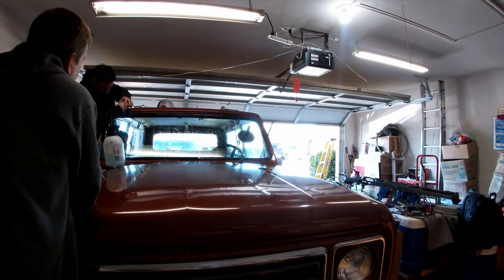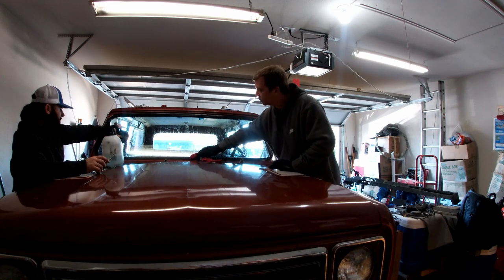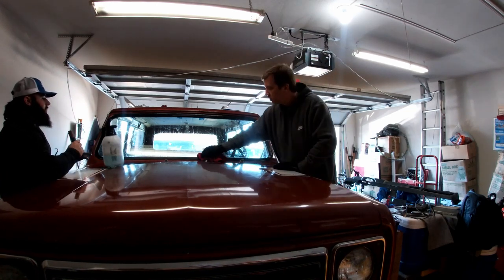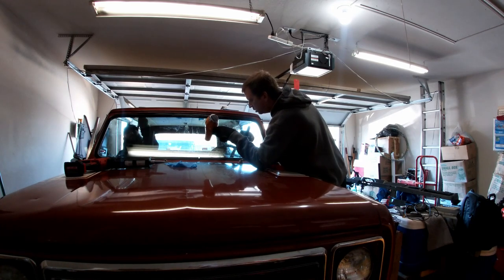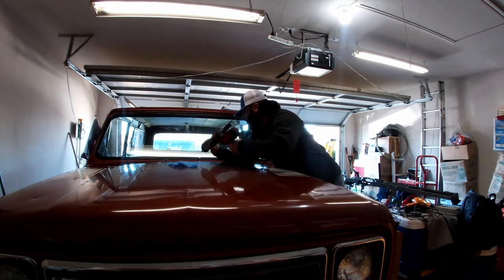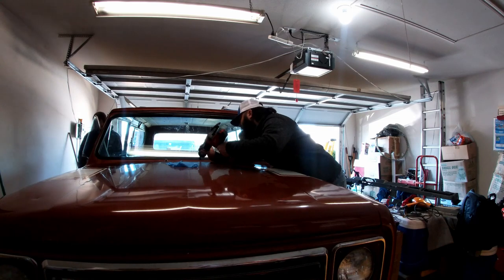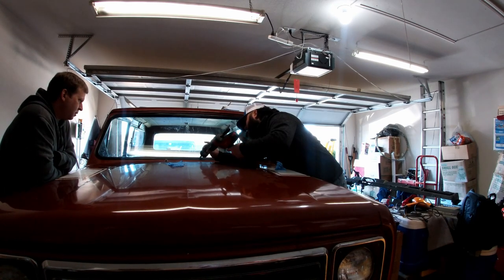After some debate, we decided to cut the seal. It says it's supposed to be there, but in our case it was so excessive that it literally made the windshield impossible to install — I really didn't see any other option. The plan was that once we got it in, we would have cut just the right amount and the two ends would butt together, but we did end up with a little bit of a gap. Am I sad we had to cut the seal? Yes. Is it the end of the world? No. We filled the gap with sealant on the inside and outside — I know it's sealed up good and it's not going to leak. I cut out about two and a half inches of seal but was left with only about a quarter to half inch gap; I just don't know where that would have gone otherwise. Once the seal was modified, the windshield went in pretty easily.